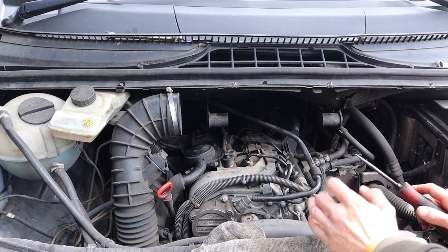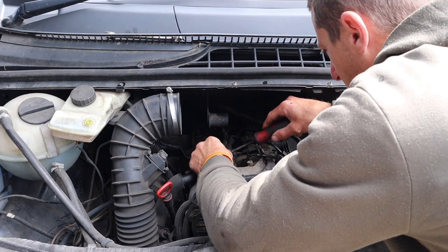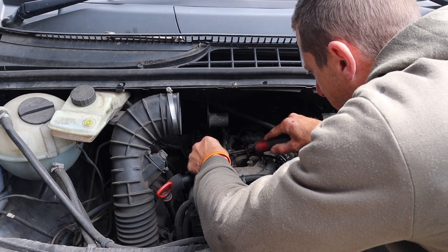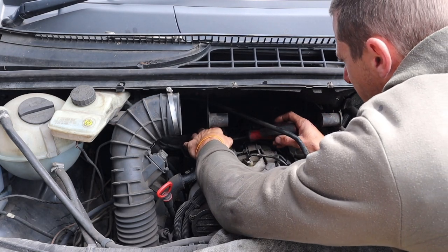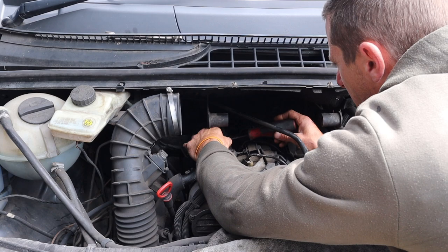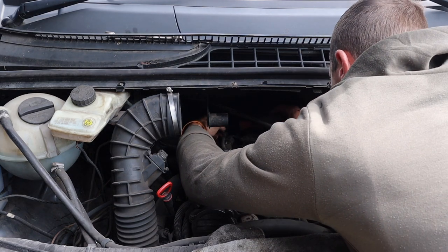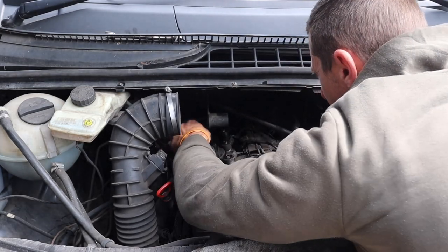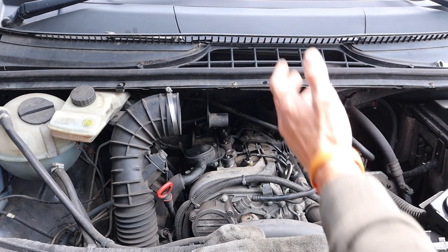Be careful when you're getting these return lines out — they're quite brittle, and if you break one the motor's stuck for a while. I've got a flathead screwdriver and I'm pulling both sides. There's one. Lift from one side, pop from the other — go easy because they do break easily. All four out. It's the same for most Mercs: the four-cylinder engines, the six-cylinders, the five-cylinders — it's all the same.